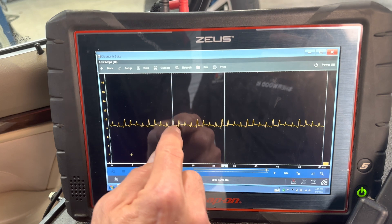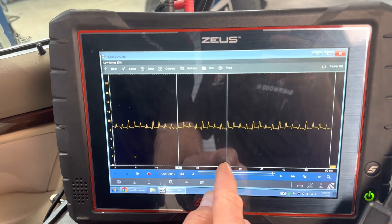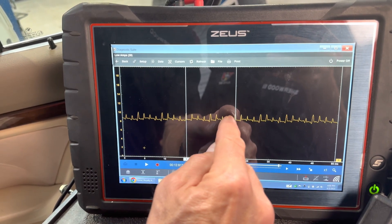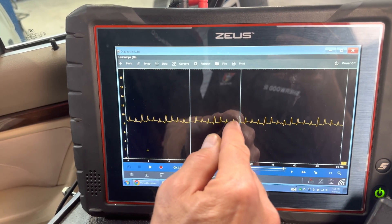We're going to have eight bars on this pump. And then we're going to get this one right here — so that's one revolution of the pump. We can see it's pretty consistent as far as the humps go. Not good humps, but the humps are there — one through eight — and we've got that tall one again.